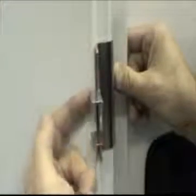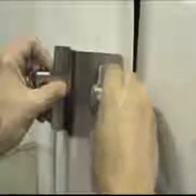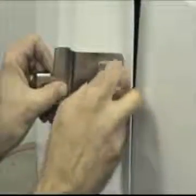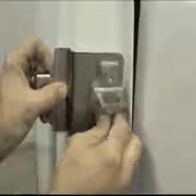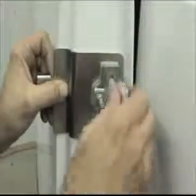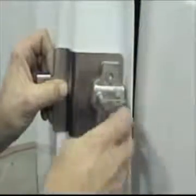After gently flattening the surface, we recommend putting the bracket against the van again to check if proper alignment has been established. Place left rear bracket over mounting holes. Reinstall striker plate. Tighten bolts down firmly, making sure bracket is seated against door sill.